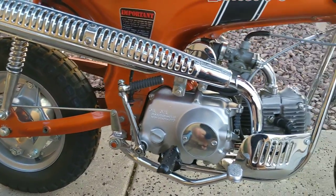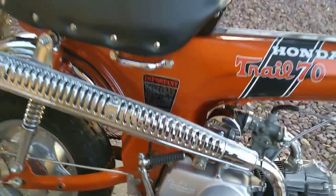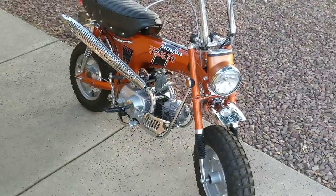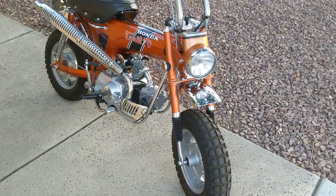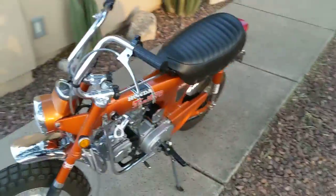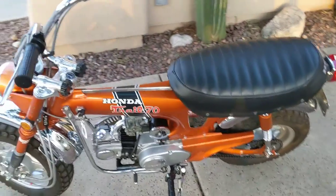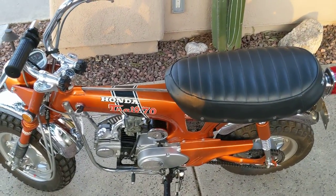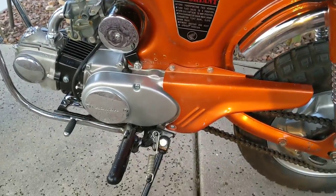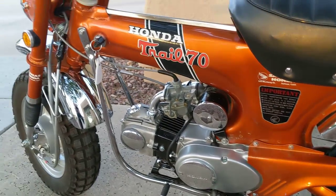It was a good thing I did the engine. Then I take all of the chrome pieces and have them re-chromed by a guy here in Tucson, Arizona named Don Jose, and he does a really nice job. I take all the aluminum parts to him as well and he polishes all the aluminum for me, which is a really big help. Then I source any new parts that I have to have. All the black painted parts on the bike are actually powder coated satin black, and that is done at Arizona Powder Coat in Phoenix.